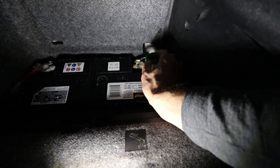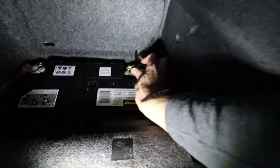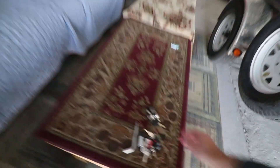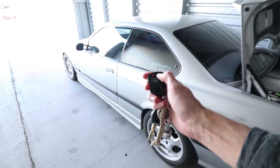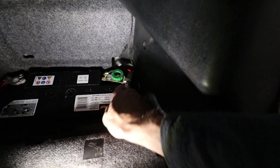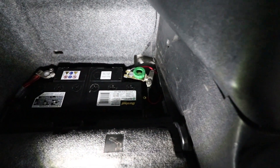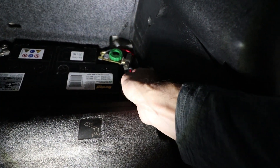So basically, you see this little hole here — this screws into here. I don't know if you heard the car beep just now, but check this out — now it works. So basically all this little green cap does is whenever you unscrew it, it breaks the connection between the negative and saves the battery from having any parasitic drop. But the cool thing about it is it has this little fuse here that connects between it so that there's still enough power to power the computer so that you don't lose the things that are saved on it, like what time it is, the date, and all the other stuff that you'd have to reprogram every time your battery goes dead.